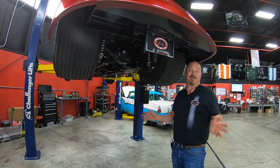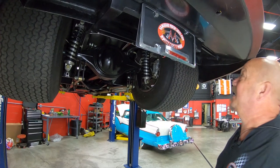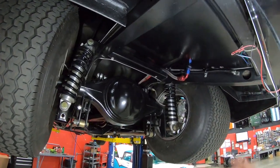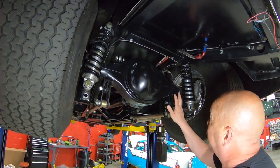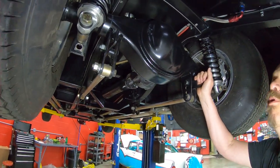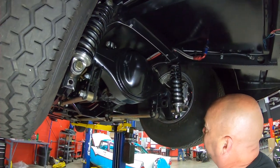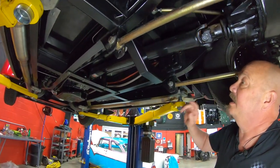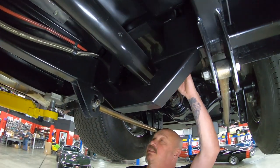We're underneath this Willys and this thing is sweet under here. Look at the frame — beautiful job, all painted up good. The whole bottom side of the car is painted up beautiful. Coilovers holding it up. We've got a four-bar setup here holding this Ford 9-inch in place. It's got right around a 4.56 gear in it. We've got aerospace component disc brakes out back. Look at this frame — look how pretty all that is. Look at all those TIG welds — they're beautiful. We've got a crossbar here keeping it nice and square.